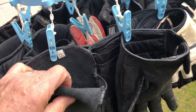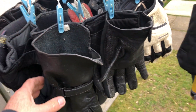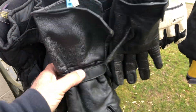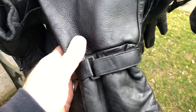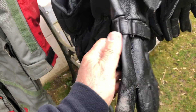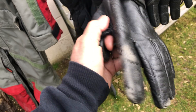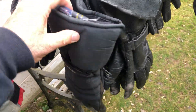When you head out in the morning and it's 70 degrees, then it gets cold on the way home, you want to keep the wind from going up your sleeves. You get a pair of gloves with gauntlets. These are unlined gauntlet gloves — I didn't want lined because the thinner the glove, the more you can feel the clutch engagement, finesse the throttle, finesse the front brake. These are pretty generic but they have a gauntlet, and I've had these for over 20 years. They are leather.